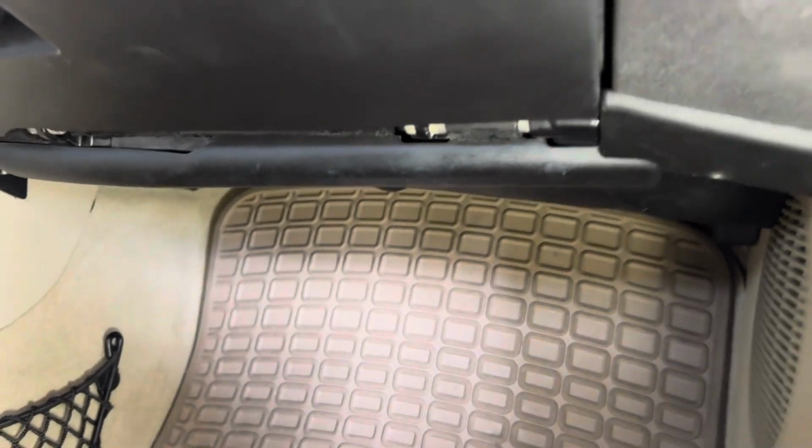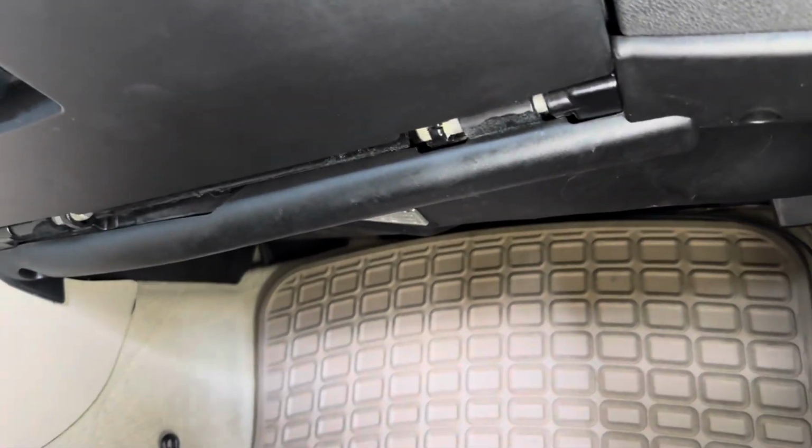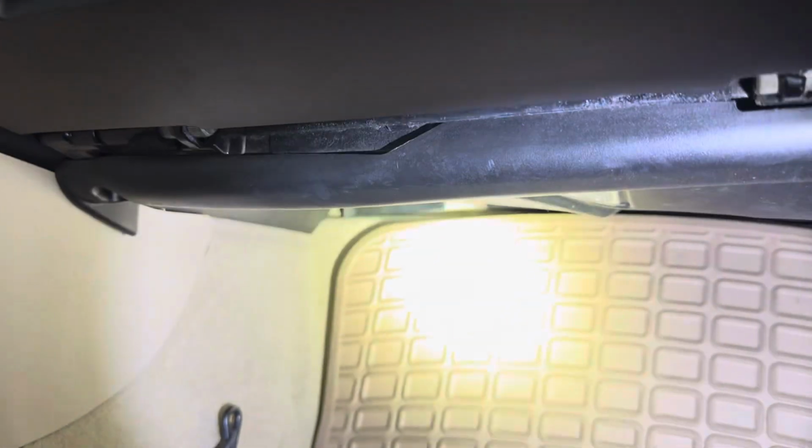So now we're just going to reinstall the door and reinstall everything in the previous order that was mentioned. Alrighty, we are now all buttoned up. Just got those screws back in place, and take your time, don't feel in a rush. Sometimes you need to attempt things a couple times, or just pull it back down a little bit and push it back up just to get all the wires to sit properly. But with it only being 2 screws and 1 little fir tree clip, not too bad overall. Next, let's move on to hooking up.